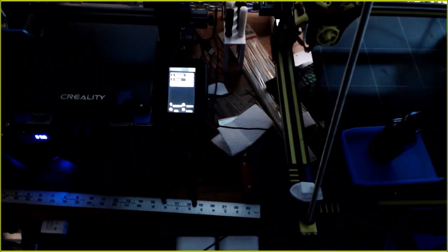And I did that by going into Control, Temp, Preheat PLA settings. I didn't like their settings. I changed them for me, which is all fuzzed out for you. Mine's set to 207 and 205. Oh, this really sucks, because that's actually blue, and it's just white for you. Get further away. Man, this sucks. This ain't going to work.